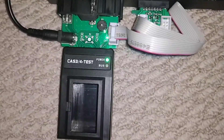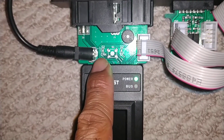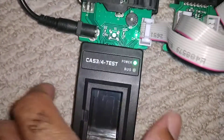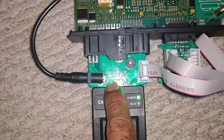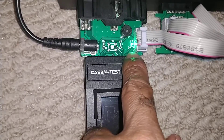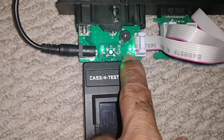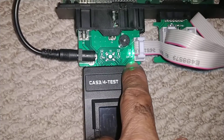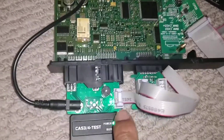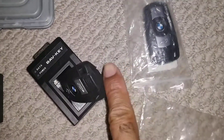Let me explain this quickly. If we see this light here — D2, where it says CAN — as long as that's on and blinking, which it is, that means the CAN bus is functioning as it should, as if it were in the car. This D4 right here is data — this light is supposed to be solid. If it's not solid or not on at all, then you have a problem with the CAS data. The solid light for D4 means the CAS data is valid, reading as being valid.